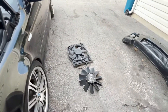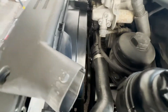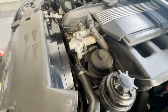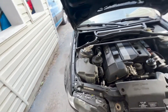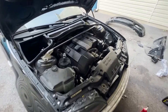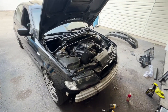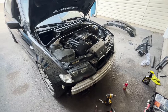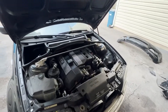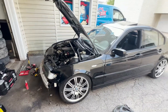You also don't have to worry about that clutch fan exploding, which will leave a good dent on the top of your hood. Here everything is free from the engine — nothing's attached to the engine anymore — so you're gonna have a more freely spinning engine, better airflow, and better cooling. You cannot go wrong with this modification. Pretty much every BMW after 2006 started using this type of fan, so this is a 2004 that didn't get the new style fan, but we retrofitted it. Looks good, sounds good too — I'm gonna take this for a spin very shortly.